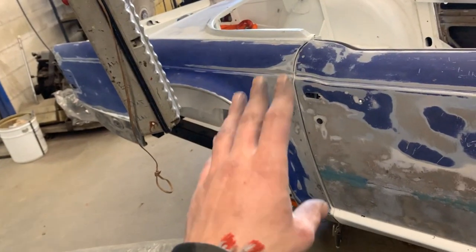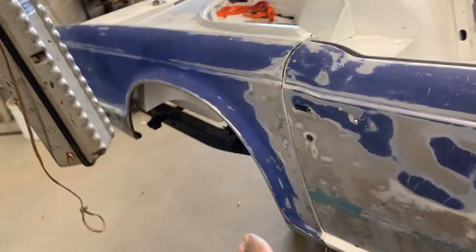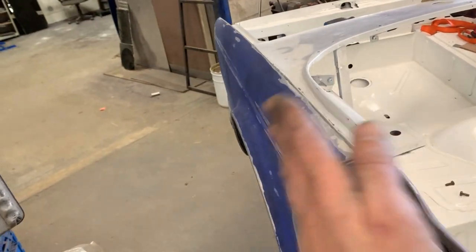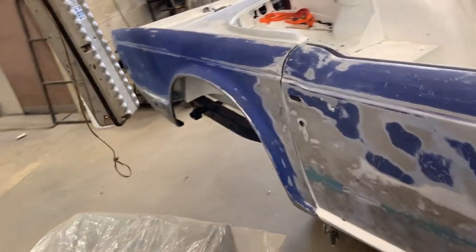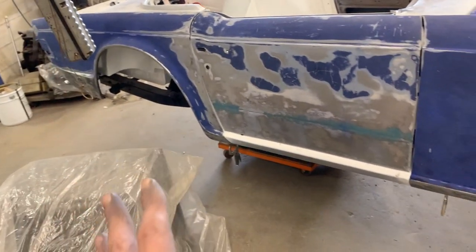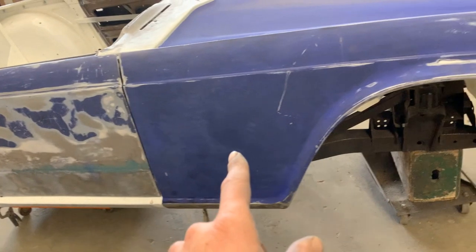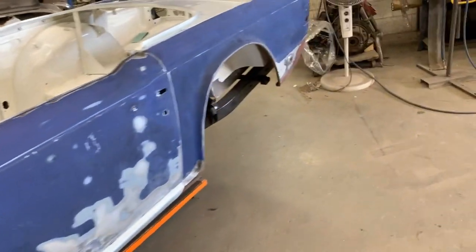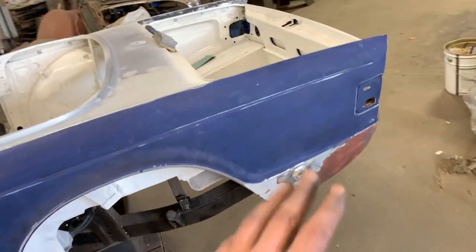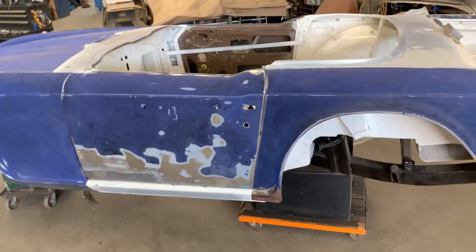The rear fenders too, they are pretty affixed where they are in the forward and backwards direction. They don't really move in and out too, so they are pretty affixed point as well. So the only panels that we can play with that are created to be adjustable are doors, front wings, and bonnet. But still, with tricking it a little bit, we can also play with the rear panels and with the boot lid. So that's my method.